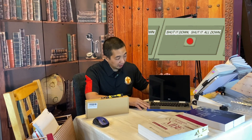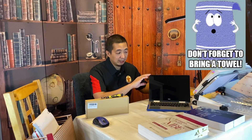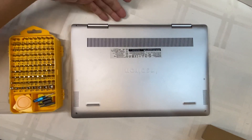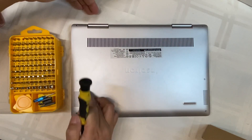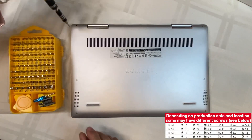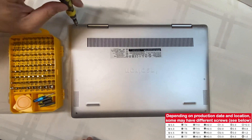Now let's remove the battery. First, make sure that your laptop is shut down or turned off. Then have a soft cloth on your table so that you don't scratch the top of your laptop. Close the laptop and turn it over to access the bottom screws. Here's the bottom of the laptop — there are six screws underneath. From my precision tools, it says I need a double zero bit to remove them.